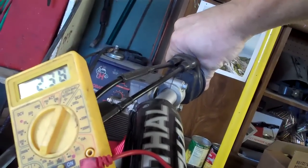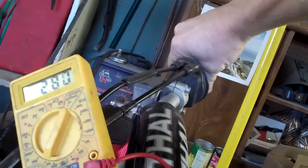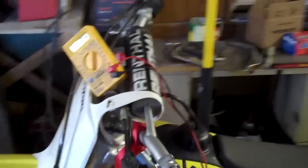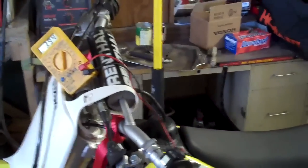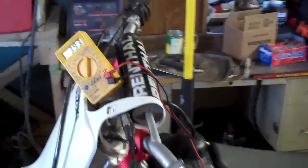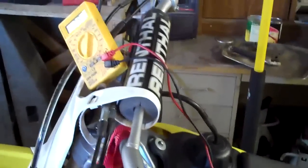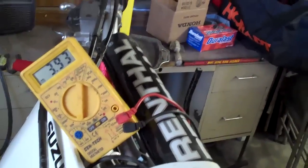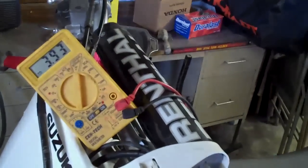That's pretty smooth - if you stop it stops, if you go it goes. So it looks like the throttle position sensor is in good shape and I can rule that out. That's how you test a throttle position sensor. If you like the video, leave a question or comment below. If you like it, rate it five stars. If you want to learn more about dirt bikes, fixing cars, or any of that, feel free to subscribe.